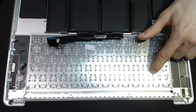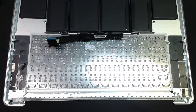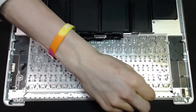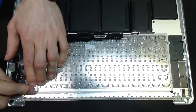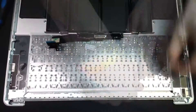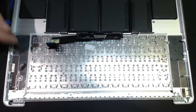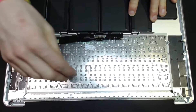I tested this on another laptop and just pressing them in you get a reasonably good hold - enough to avoid any squidge. This little bit of movement, that little up and down you can see in the reflection, that's what we want to get rid of, because you'll feel that when you're pressing the keys on the other side. I'm not going to put in every single rivet - I'm going to put in every other hole and that is enough. We'll go to fast forward while I do this. So we've put in a replacement rivet roughly every other hole, and there's no flex, no movement - happy as Larry.